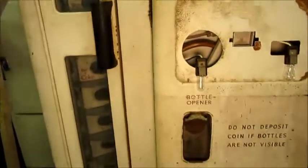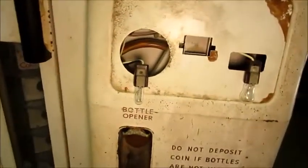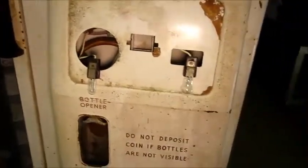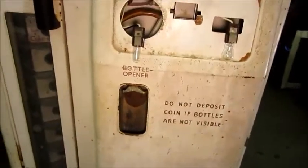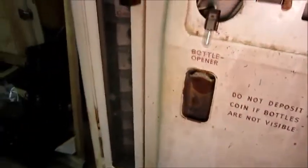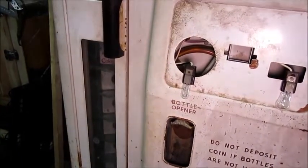Mechanically and electrically everything's working fine. I'll be real excited to see this new faceplate — it should make this thing look a lot better. I'm going to temporarily install it, but we're not going to actually glue it on because the exterior is going to get a new paint job. For now it's going to stay plugged in here for a cooling unit test run for several days. I'll probably load it up with some water bottles — that's the best way to know if it's cooling properly. The bottles should be cold to the touch but not frozen.